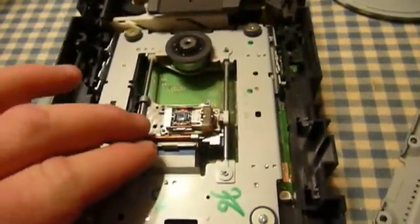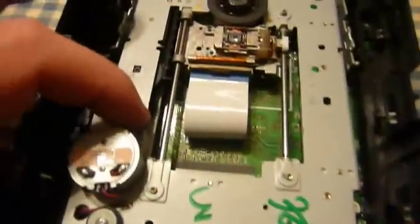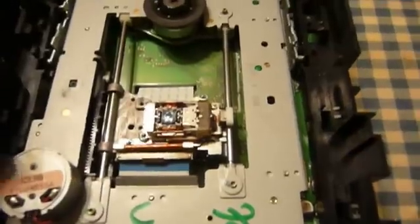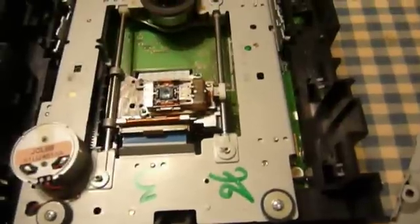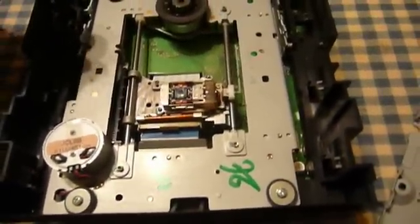When you're in here, you can look for faults and make sure that this little sled moves smoothly. There's definitely some evidence of dust in this drive. The appearance of the laser diode lens right here can be important. This one's not shiny and clear with a bluish or purple tinge to it — it's actually got a bit of fuzz on it or something. So I think that's why this drive has been acting up.